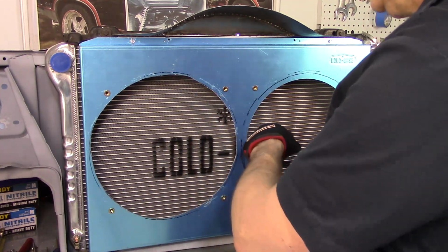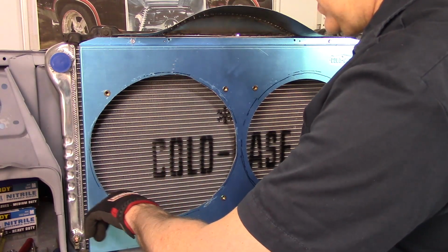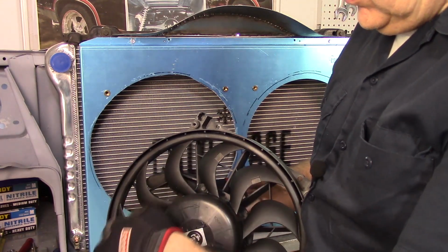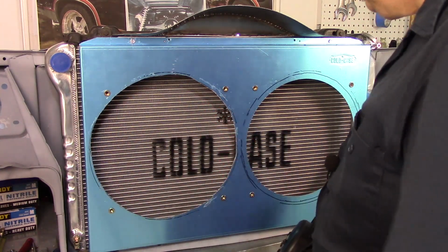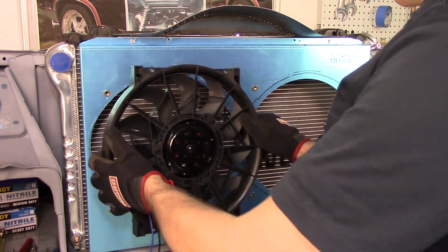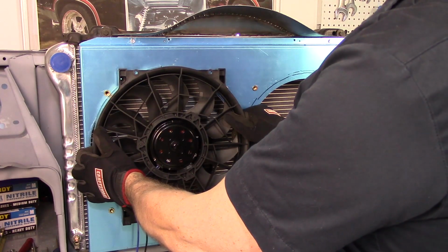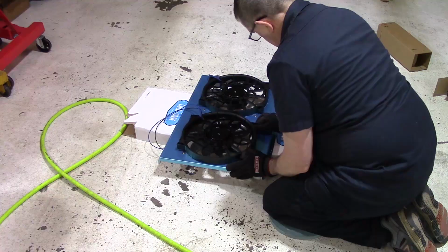Yeah, so I still got to cut out the second hole, and I've got to finish this a little bit more. It needs to widen up in a couple of spots because I'm still getting just a little bit of drag, just enough on the lip in a couple of spots. So I just got to open up a couple of spots around here, do the second one, and then I think I will just run down probably just sheet metal screws to start off with. All right, well, now I got to take this back off again to do more work.